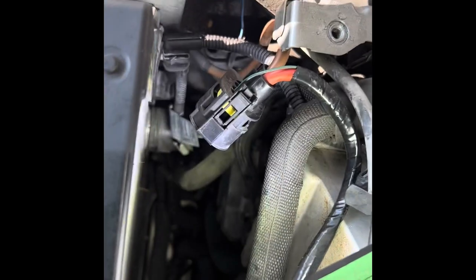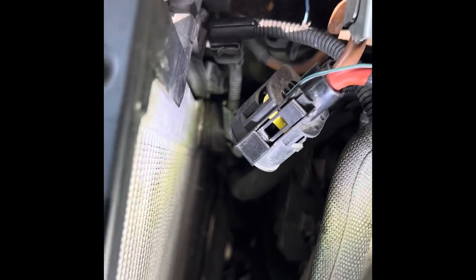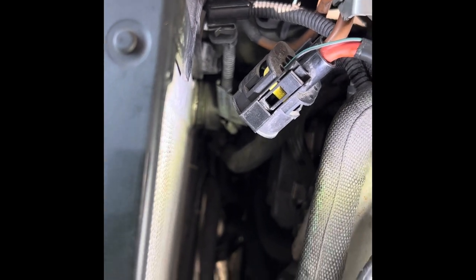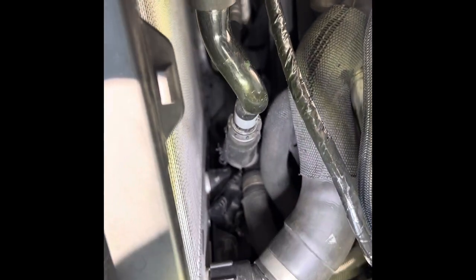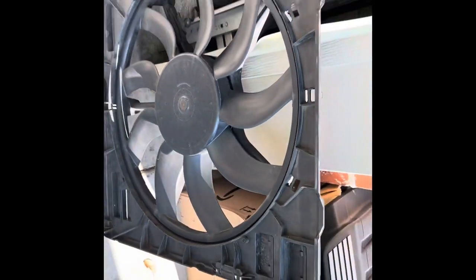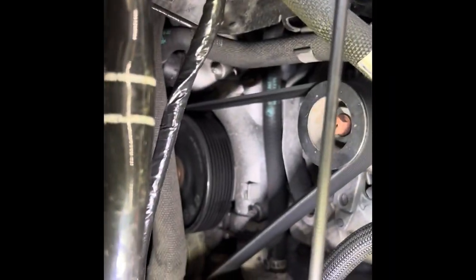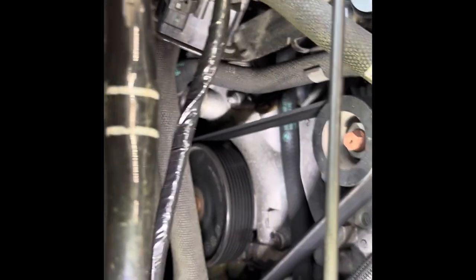Something to pay attention to: there's a fan plug on top, and there's another wiring harness attached to the fan. The top hose was also snapped into the fan, and there are side ears on the fan that are held to the car. But otherwise it depends on the way — there's the water pump, and I've still got a good ways to go.